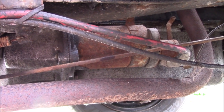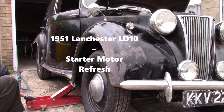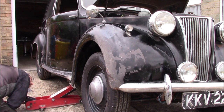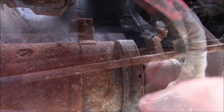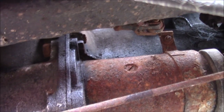One of the problems we've had since getting the Lanchester is this starter motor. There's not really any benefit to removing the wheel, so I've saved myself some time by not doing it. There's one bolt here that's been removed. There is that one there to take out, and then this one here. There's also the cable, the power cable to remove. The battery is already disconnected. We only connect the battery when we need to start the car, the rest of the time it's just disconnected to avoid any problems with fire, and I'm going to try and take that out.